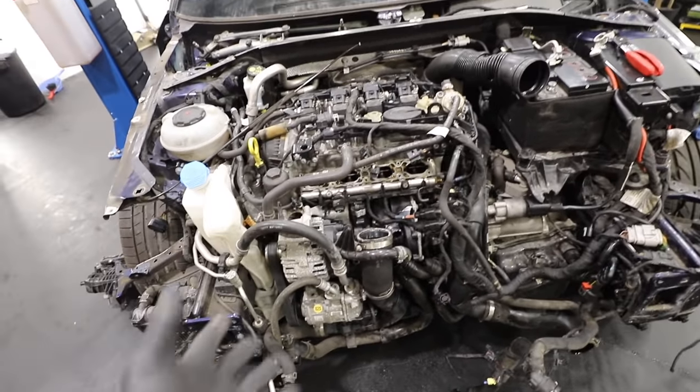There are bad noises but no warning lights on the dash at all. There's possible plastic still in there. It started, which is at least something positive. My initial thought is that the broken throttle body could be the issue, or it could sound like an injector problem — or I may have left something unplugged. It is misfiring badly.